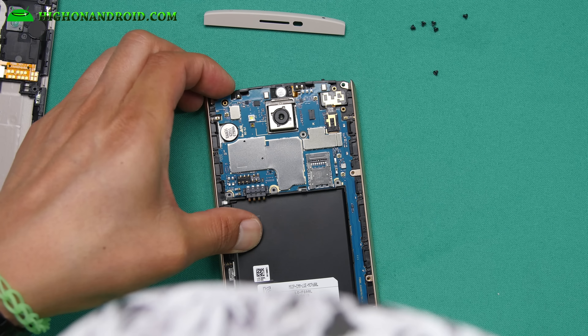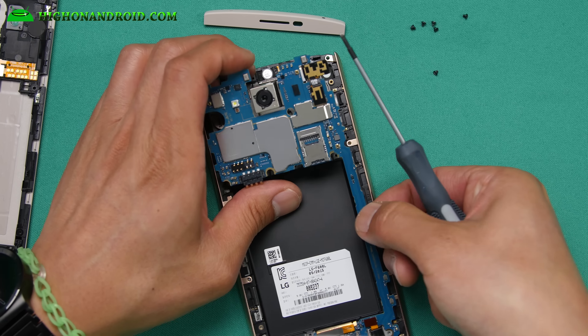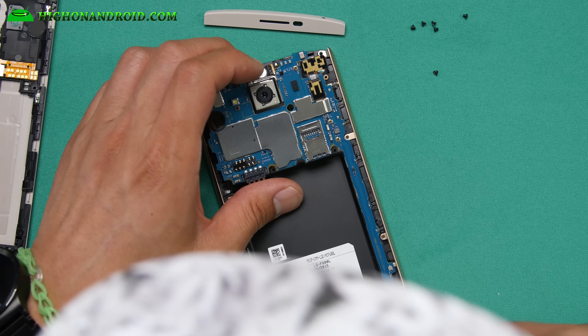Next, we're gonna go ahead and try to take the board out. It just kind of pulls out, and it's connected by these connectors here. Make sure you undo this bottom connector — I think this is for the LCD screen. Go ahead and undo this one for your 3.5 millimeter headphone jack. And boom shakalaka — we got the motherboard out now. The USB port is baked in, so you can't just replace the USB if it breaks, so just try not to break it.